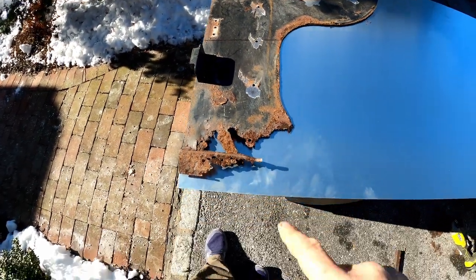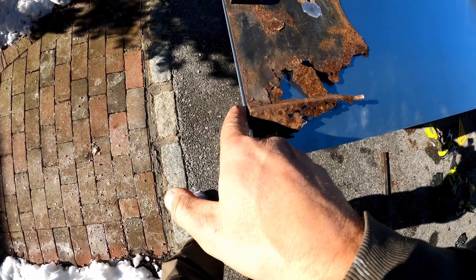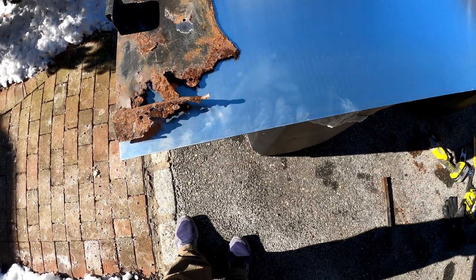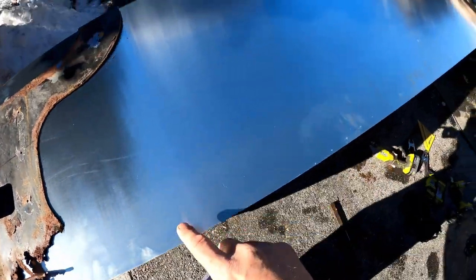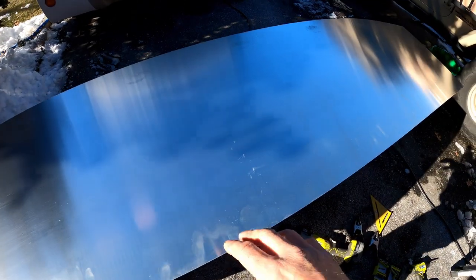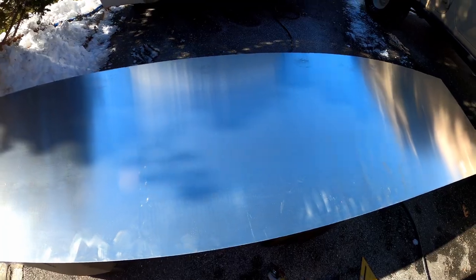At least I know my radius cuts here, kind of where the front is — this is the old lip edge. I'll measure and find out where my bottom is, then keep an extra portion on the bottom, score it, and do a lip underneath where I'll seal and rivet from the bottom as well. This radius cut comes right here, so I should be able to get both runs out of this one sheet of aluminum if I do it correctly.